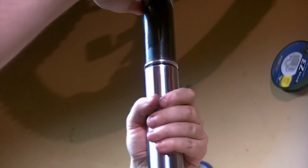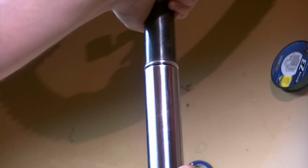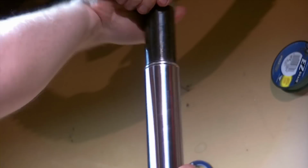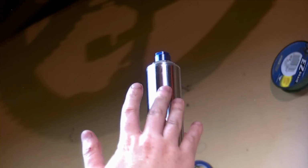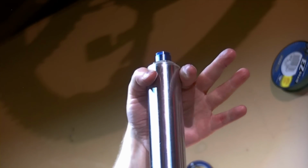Okay, we're going to have to get the socket on there. Actually torque this, you have to hold this as tight as you can. You might need a friend. You could put it in the jaws, the vise, with a lot of extra towels. You really don't want to squeeze too tight on this. But it's also key to note we don't want to clamp anything here, because that's going to pinch those threads again. Just like when we were in the triple clamp on the bike, we don't want to have pressure as we're torquing that down, so you want to grab a little bit lower. I'm going to look up torque specs and set that up to torque the cap. Had an obvious bonehead thing to do.